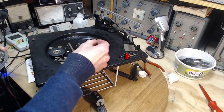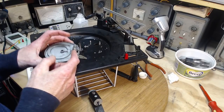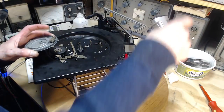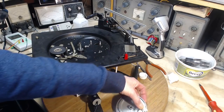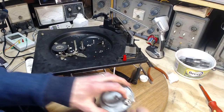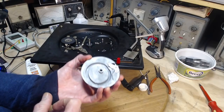That's why if you pick up your tonearm and try to bring it into the center area as carefully as you can, often it'll just grab it and start moving it back. Because you moved it fast enough that the kicker couldn't kick away the mechanism, and you end up engaging the return function. So that's exactly the way it should be. Now we haven't got the top E-clip on yet. Put this guy back on — maybe I can just push it on. There we are. Still all moving freely. Perfect.